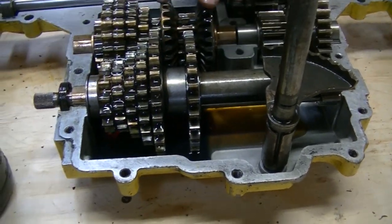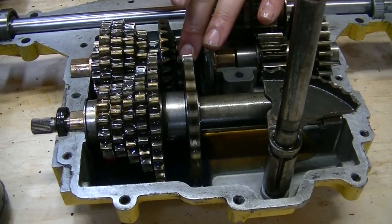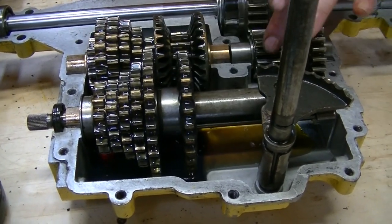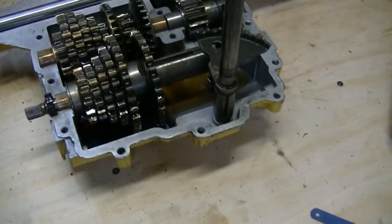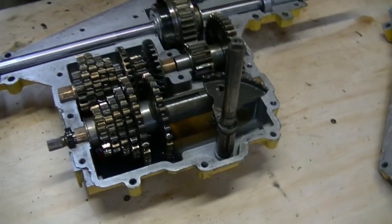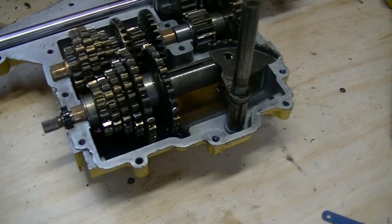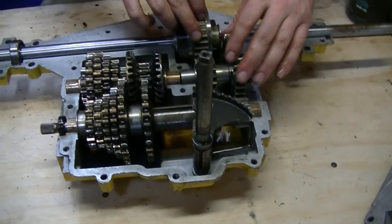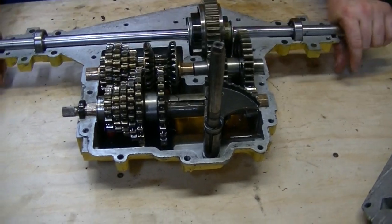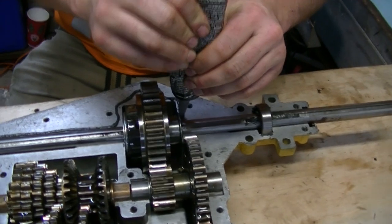And if you'll notice, when I spin it, you can very much see that it's pulling the oil up. That's like that little gizmo at the auto parts store with the Lucas oil stuff, and you play with the gears and spin it and get it all stuck into the gears. Yep, that's it. That's basically what you need. I do not recommend overfilling it because that's when it starts seeping past seals and getting ugly and nasty. You do not need too much gear oil. You just need enough. Just get yourself a nice bead.